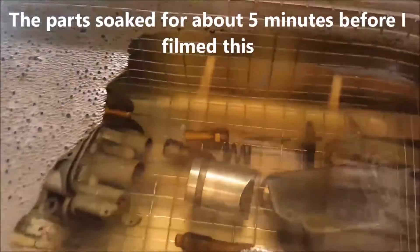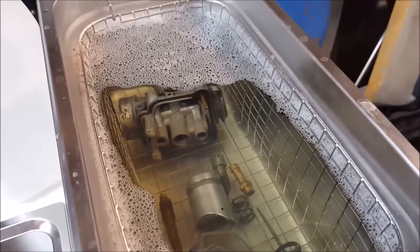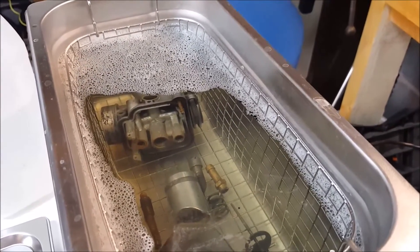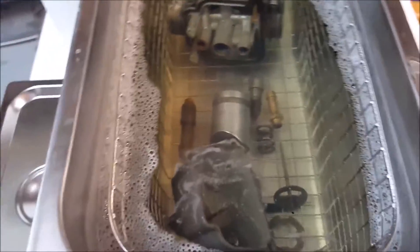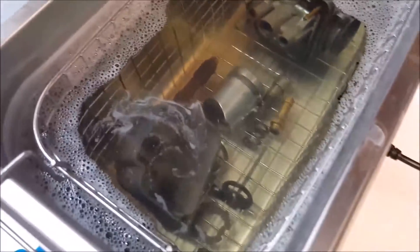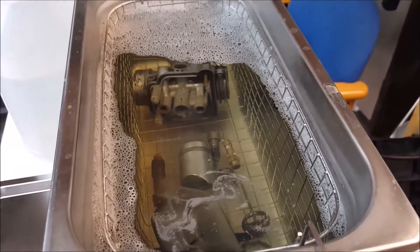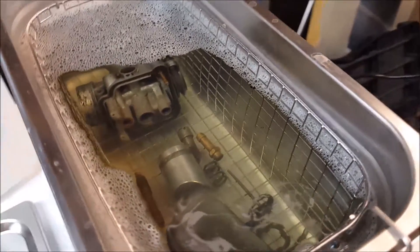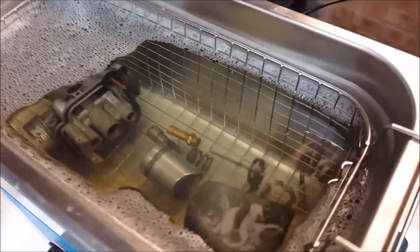I've got the actual bits and pieces of the carburettor in the water now. When I first put this in, the water was perfectly clear. I believe the physics of these things is that the ultrasonic creates micro-cavitations inside the fluid, and then when those micro-cavitations collapse, you get an extremely high temperature for a very short period. I'm actually leaving these to soak in the fluid for a little while. Normally the fluid you use just needs a surfactant to ensure the ultrasonics make good contact with the surface of whatever you're cleaning, but in this case I believe the carburettor cleaner is probably a combination of a detergent and strong acid. As you can see, the water's going yellow already, so it's clearly doing something even without the ultrasonics on.